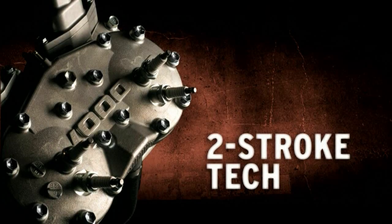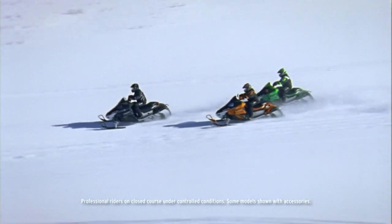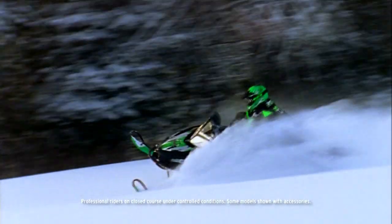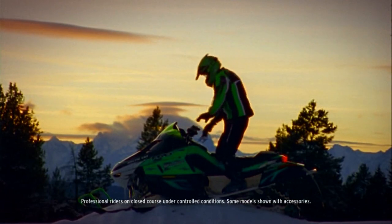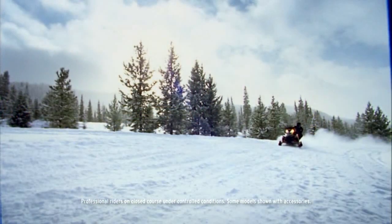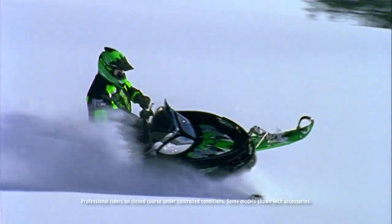The first person to lay eyes on a snowmobile just wanted to ride. The second wanted to race. And so it began: the quest to build the high-performance snowmobile. Battery-less electronic fuel injection adjusts for temperature and altitude. Expect quick starts, great fuel economy, and cleaner emissions. The exhaust pipe temperature system and electronic APV exhaust valves regulate pipe temperature to optimize performance and reduce emissions.